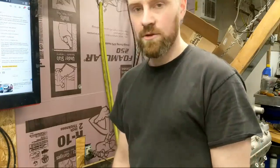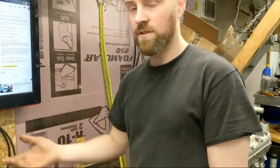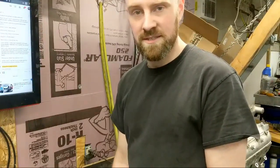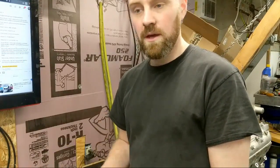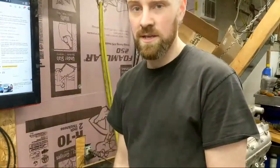Furthermore, the disablers themselves, those little devices, say you're getting in and out of your car. You're at the grocery store, for instance. You get your groceries. You get in. Your knee bumps the disabler, and it falls to the floor, but you don't notice it because you have your kids or whatever screaming in the back. Either way, you don't notice it. It's sitting on the floor. You fire up your vehicle. You take off, driving in town to get back home, and it goes into four-cylinder mode. Now your lifter tick is back. So disablers have their purpose. They're very good for a vehicle that has not had a problem yet, to keep it from having a problem. After you have it, except for maybe to get you to a shop, other than that, don't bother with the disabler. It's not worth it.